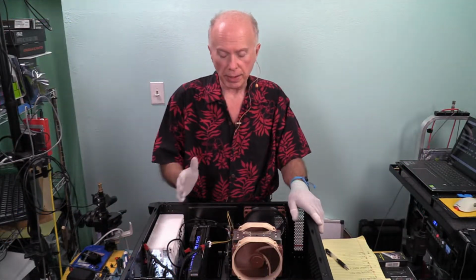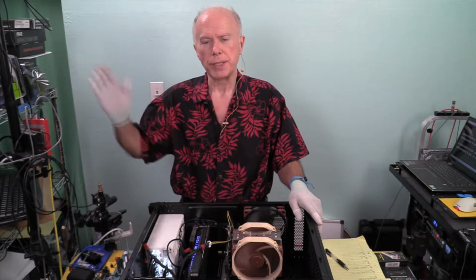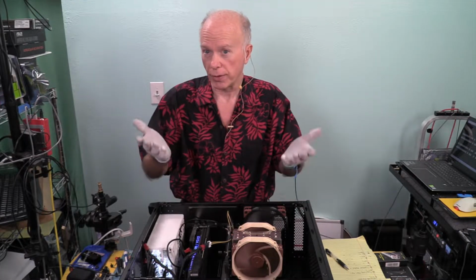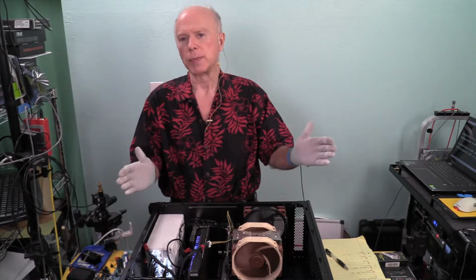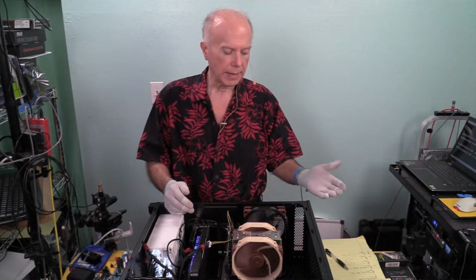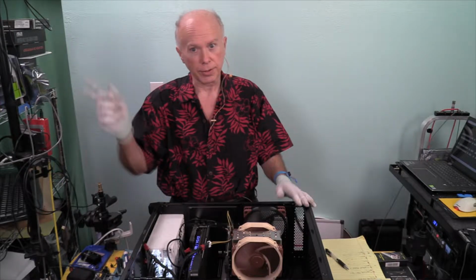The point of that, as I look at these numbers and these charts for what we've just done, is we've established the faster we go, the harder we go. Where PCI Express 3.0, no matter what the drives are, they can't go any faster than what they're capable of because of that PLX chip. So let's take a look at our heat chart right quick, and I'll explain some of that, because these numbers are going to be added to that chart. In fact, our chart, because of what we're doing, is now going to have to be 2 pages. Let's look at the chart.